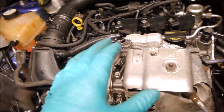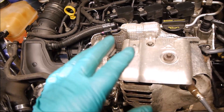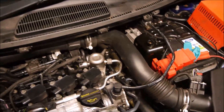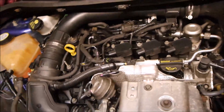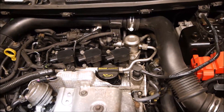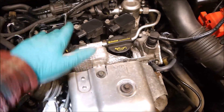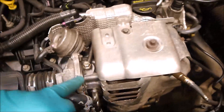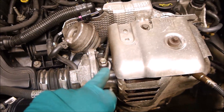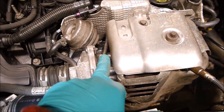You'll kill an engine if you just try starting it with a fresh engine that hasn't got oil everywhere and hasn't got the oil pump primed - you could potentially cause a lot of damage. I'm going to do a once-round check to make sure I've got everything in place. It's quite a compact engine - there's absolutely no space, they've really done a good job packing it in, though it is a bit awkward to work on. The plan is to get it to turn over, which will get some pressure up in the fuel rail and the oil. I'm going to crack this little banjo fitting here on the turbo - I want to see oil coming out of there so I know the oil has got to the top of the engine and it's priming the turbo. Until I get oil coming out of there, I'm not going to try starting it.